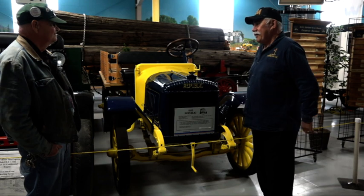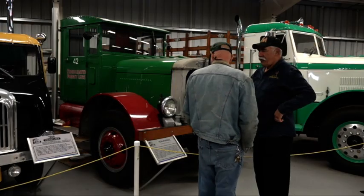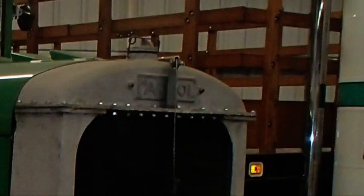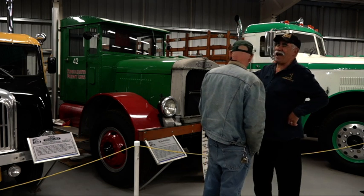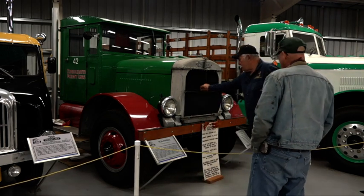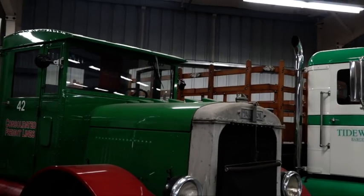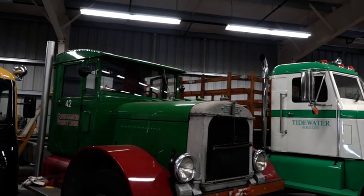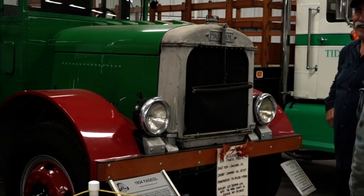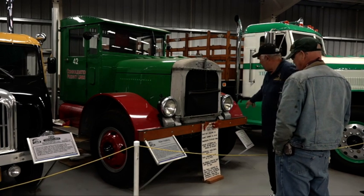This 1934 Fageol — it's a big truck. Looking at it, it's got a square cab. The engine is 150 horsepower — 150 horsepower in 1934! What I like about this is the little blind arrangement up here: obviously you could pull a wire in the cab to add a bit more heat to the engine. In our time we just put a bit of canvas or cardboard over it. This is pre-louvers — remember, trucks came with louvers? Now they've got automatic louvers, and the truck thinks for itself. You just have to steer it. There's a wooden bumper across there and some decent headlights.